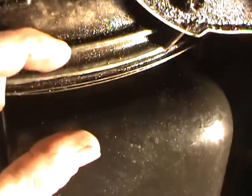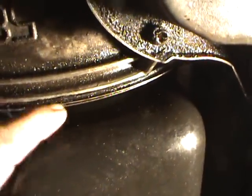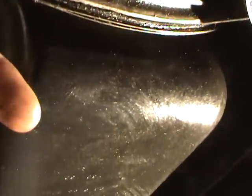Okay, let's move on. Once you drop this oil pan, the oil pump inside hooks up. It won't allow you to get to it, but it gives you a little room so you can get up there with a 13 millimeter, and you got to drop that down and drop it all together. So when you put the gasket back up in there, you can't put the oil pump in there, you gotta have it hanging in the oil pan. It's out of control because it's got a baffle in here. Once you get the oil pan up so far, you hang it up with your knee, reaching up in the side with a 13 mil, because you don't want to use a socket because you'll drop it down in there, yeah, I've done it. And then you're gonna need a little magnet thing to pull the wrench back out because you're getting irritated. Anyway, it can be done.